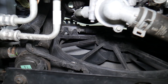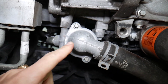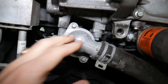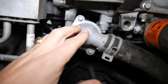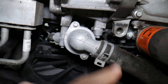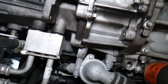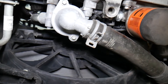Next: the thermostat. A thermostat stuck closed — and in some cases even stuck open — can cause overheating. If it's stuck closed, the car will overheat quickly. This is your thermostat; we have a video on how to replace it. When stuck closed, coolant cannot flow between the engine and radiator, so cold coolant from the radiator cannot enter the engine.